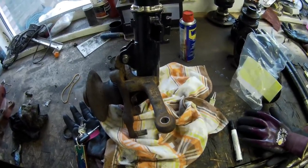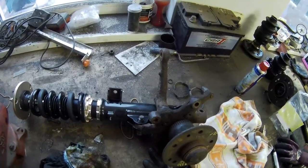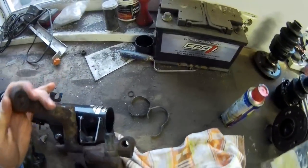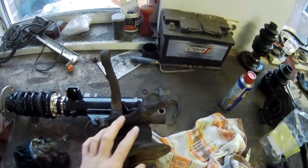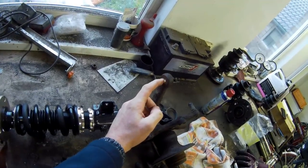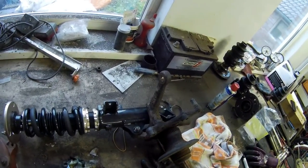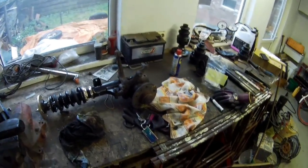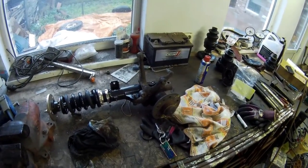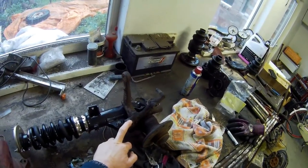Just for a little bit of information: the wheel hub of a W201, W124, and R129 are all completely the same. The only difference is the mountings of the brake calipers — they can be a little different because you've got bigger brakes — and the holes for the steering connections are bigger. But the positions of all the connections are perfectly the same.